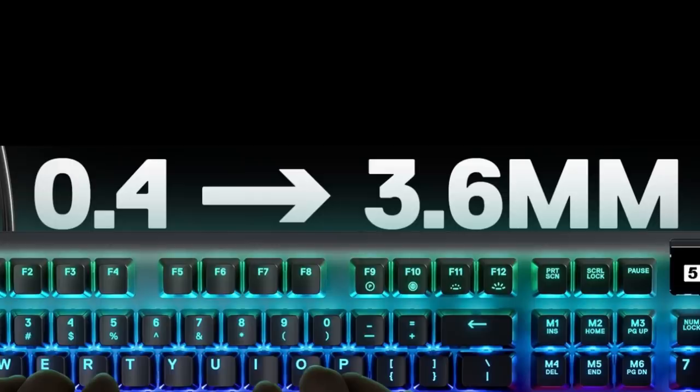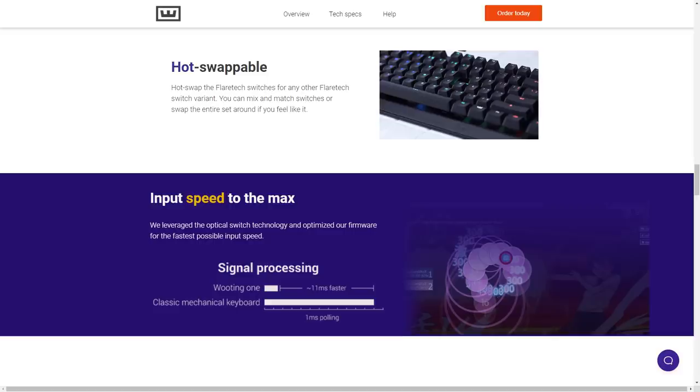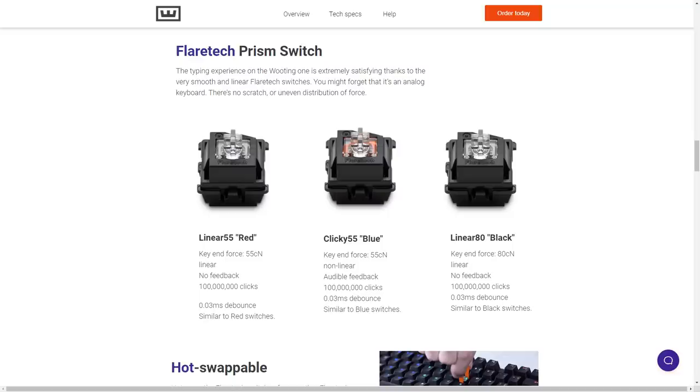Some other keyboards, like the Wooting, also benefit from this faster switch response. Basically, there's no point in trying to truly quantify these numbers, so let's just divide them into two categories: keyboards which have debouncing delays, which are therefore on average slower, and keyboards which don't, which are therefore on average faster. So yeah, in short, forget the 5x and 8x stuff, it's simply faster than a contact-based switch can offer, period.